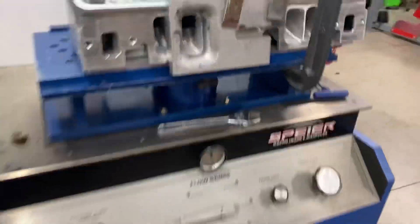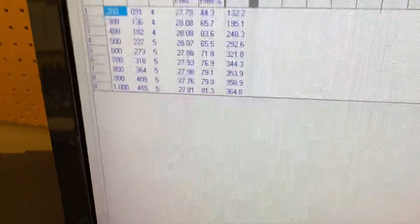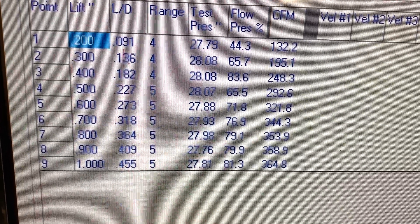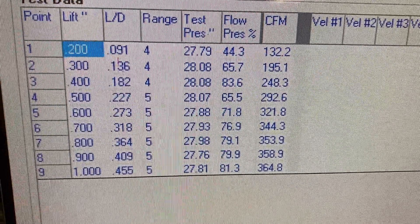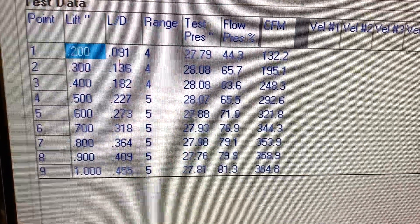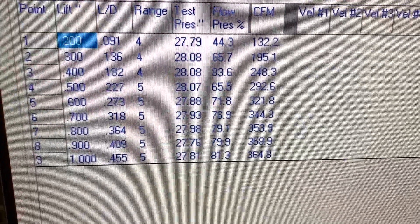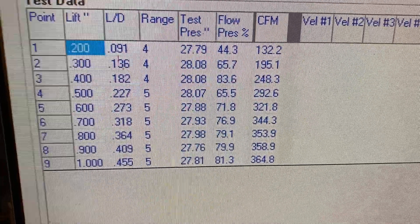4155 fixture — that's exactly how I flow it. I put a head bolt; I don't put a sleeve in it. Billet plate. 200 to 1 inch. It moves some air. Straight up, true 23 degree. Not a 21, not a 22 — straight up old school 23. 23 degree is alive and well, kicking ass at SRH.